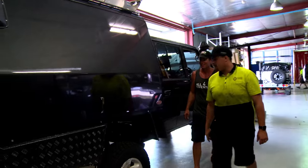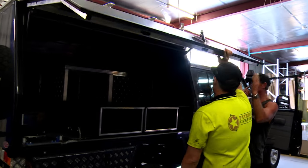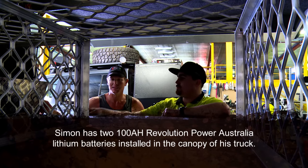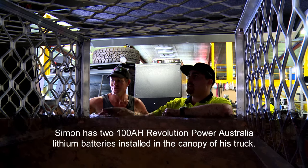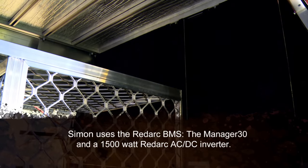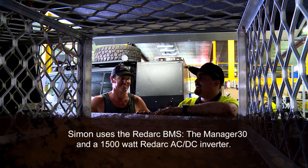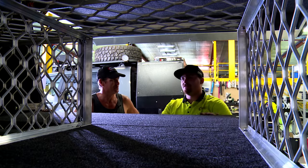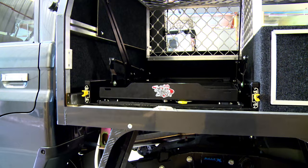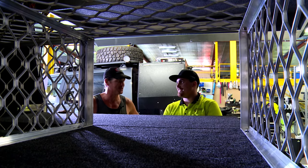What's going to happen in the canopy? So we've got a concept canopy here. Up front we've got 200 amp-hour lithium batteries from Revolution, housing a nice storage area there. Up the top we've got a Redarc BMS S2 1230, and we're also going to have the base plate on the front here. You've got a fair bit of work ahead of you. The switches, water pumps, fridge, all the wiring to go for your rear winch. We've got drop slide and stuff like that. So that's the next stage — we're going to start wiring up.